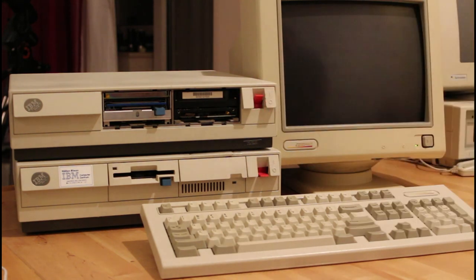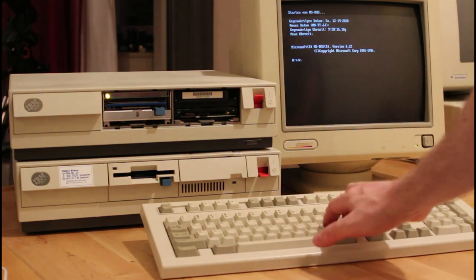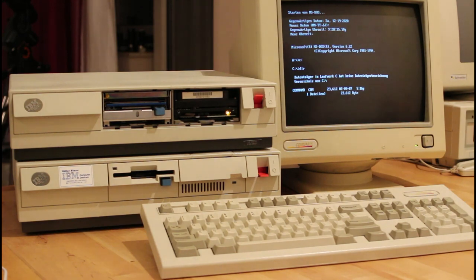Let's see if this machine fares any better. I'll switch it on — I expect 640 kilobytes of memory, a completely standard configuration, so no surprises there. The difference is that the floppy drive seeks in this machine. In case you're wondering, it's not the battery — I've actually switched the drives over to check and that first floppy drive is definitely dead, this one is working. It boots just fine to DOS, and what's even more amazing is that the hard drive actually works. It's completely blank but this appears to be a 20 megabyte drive that's functioning.